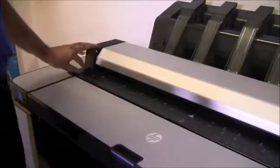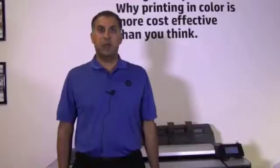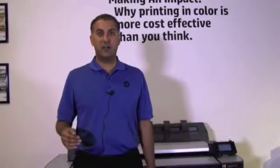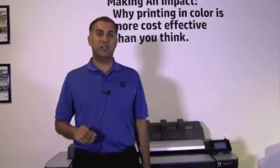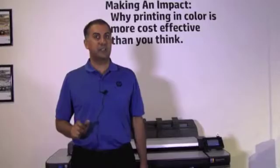When requested by the front panel, open the window using the release lever. To access the printhead, raise the blue carriage cover and then pull the cover towards you, raising the black piece to which it is attached. Grasp the printhead by the blue pieces on each side and then lift the printhead out of the carriage.